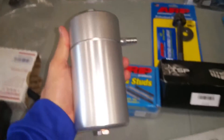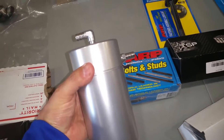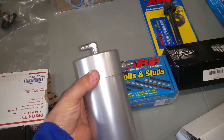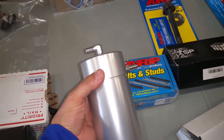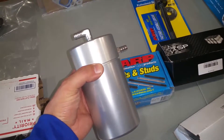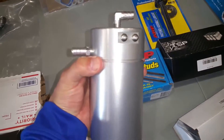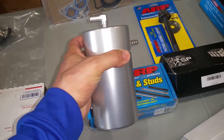Over here — you may recall from one of my earlier videos I was getting a lot of blow-by, and some of that would leak into the air filter, drip down the front of my intercooler, and I always had oil there. So hopefully I can mount this oil catch can, which I got from LG Motorsports. It's a nice piece and hopefully it'll solve my blow-by issue.